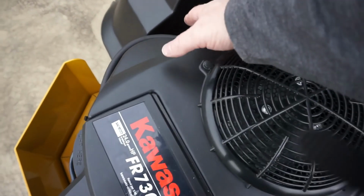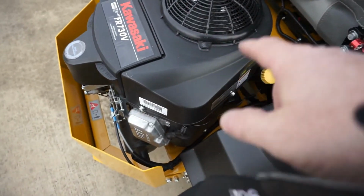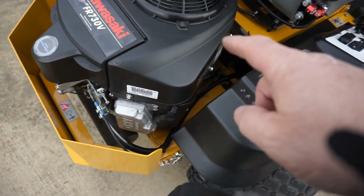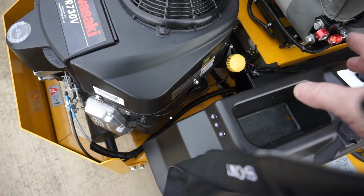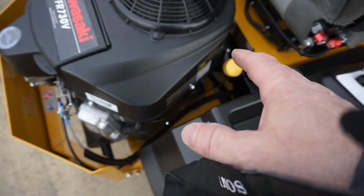Well, you got to also take the 2 screws out of your fuel pump. Then this cover will pop off. So I removed the inductive wire from the spark plug and I brought it to the outside. So it fired right up, but the engine isn't warm. So we will go ahead and do a test on that.